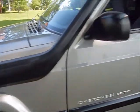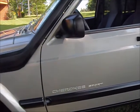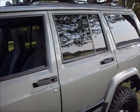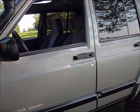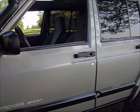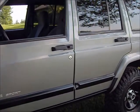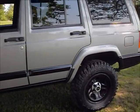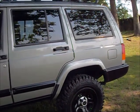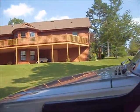It's got brand new shocks in the front and brand new shocks in the rear along with the lift. The rear I put air shocks in because I had a camper — I wanted to make sure I didn't squat in the back. I hate seeing trucks squatting down in the back driving down the street. So it does have air shocks and a set of helpers on the back just to stiffen the rear up, but it rides real good.